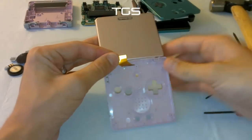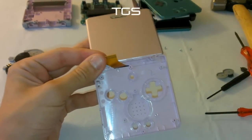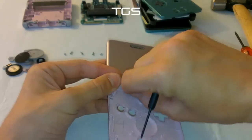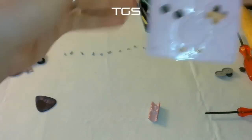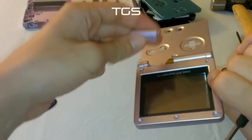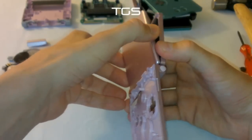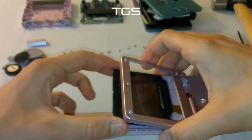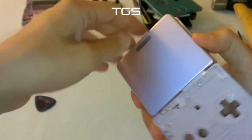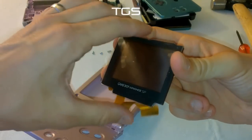The way to get the screen out — as you'll see here — is a tiny little Phillips screw just under the ribbon. Just gently take that out and pop it in order. You'll notice that the little piece comes off — that is what the screw was holding, which in turn holds the two sides together. Once you've done that, it's easy enough to just ease the ribbon out. You don't want to pull it and force it — just put the ribbon at an angle and ease it out. There you go, and you've got the screen. Put the screen to the side.